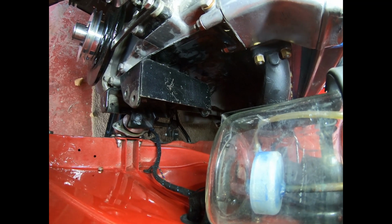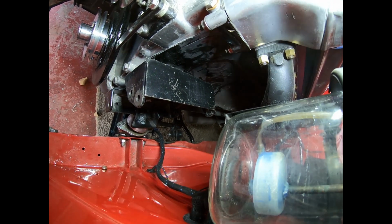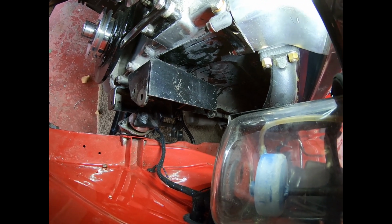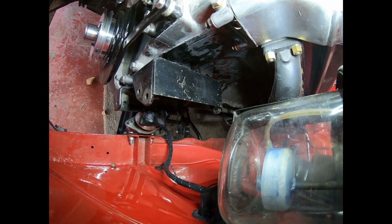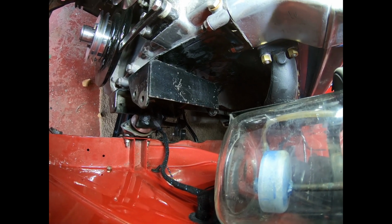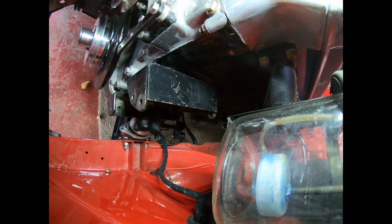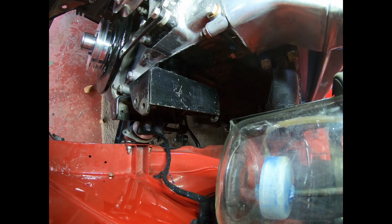Now, I've got to wait. I've ordered what I looked at in the picture that said left-hand side. No, let me re-say that. Sorry. They called it right-hand side. The picture was a left-hand side. Once I get the piece and I am 100% sure, then I will notify that person, hey, you're listing it wrong. You're saying it's left hand when it's really right hand. A lot of people make the mistake by looking at the car standing in front of it. That is not how it is. It is always described from sitting in the vehicle. Doesn't matter if it's a left-hand drive or a right-hand drive. Doesn't matter whether you want to call it passenger or driver's side. That is wrong. It is always done sitting in the vehicle, facing forwards. So you know what is left and you know what is right.